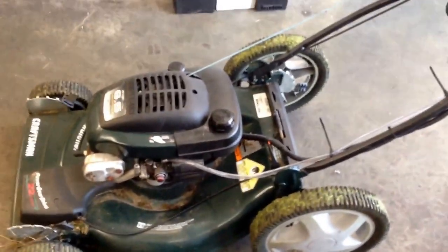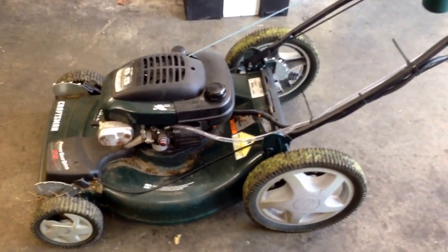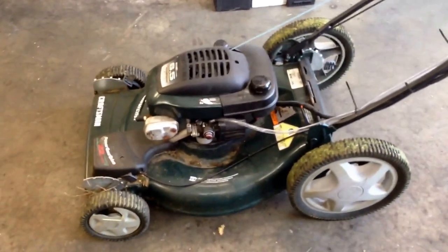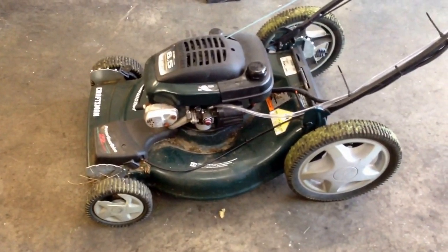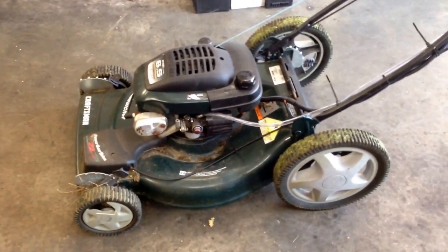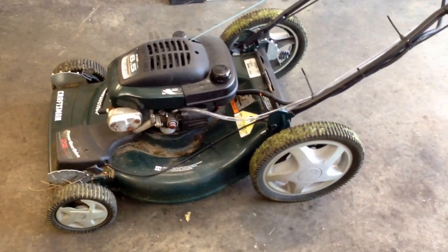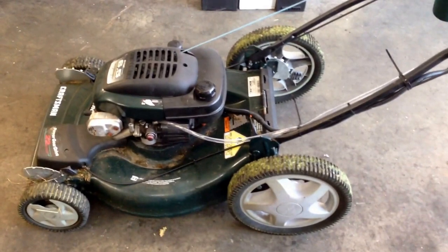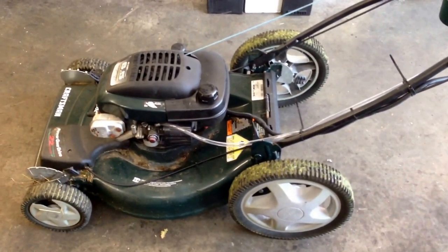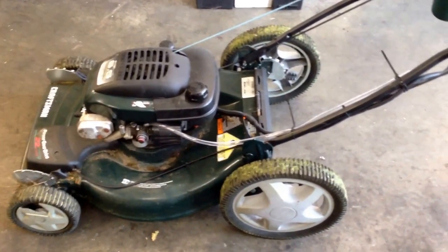The neat thing about it is — with a lawnmower, the fuel sits in the float bowl and you have to put an additive in the fuel to let it sit over the winter. Like this thing, it took about 10 or 15 pulls to even get it to try to fire off — probably could use a spark plug too. It's only a three-year-old model and hasn't had many hours on it; that's just the carb with fuel sitting and getting nasty.